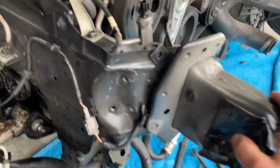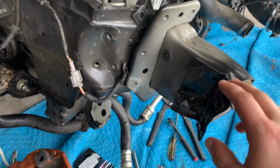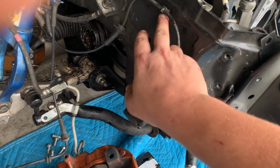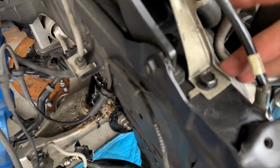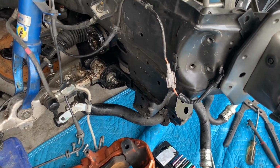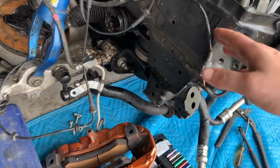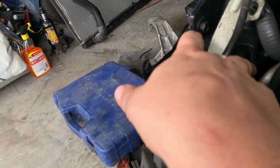And then this is the main culprit that I need to fix. Get on the frame, straighten it out. Probably, I don't know, cut it right here somewhere. Maybe even right here. And then on this side, a little bit further back. Because you don't want to cut straight down, because then it loses its rigidity. But if you cut basically where it's not bent, first pull it as much as you can, and then probably cut it here, and then back here.